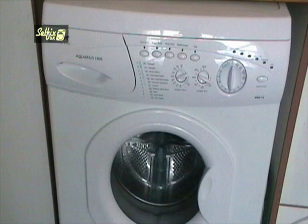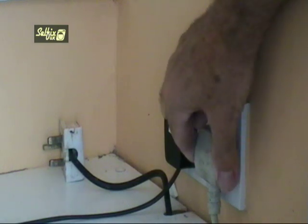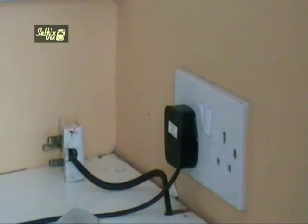On this particular range of washing machine there are a number of different control modules used, and it is possible to fit a control module from one machine within a given range onto another and reconfigure it to work on that machine. But you do need to know which machines use which modules. This information and configuration data is freely available on our website at selfix-uk.co.uk. Before you attempt any repair on a domestic appliance, first remove the plug from the mains power supply.